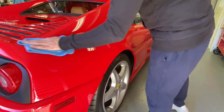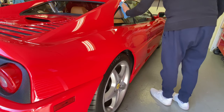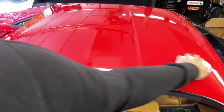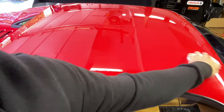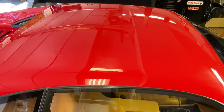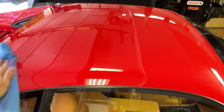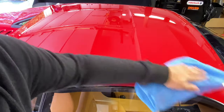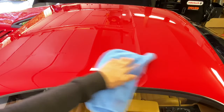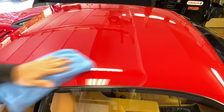The car is pretty much ready. I started the waterless wash outdoors so the sun could hit the car and I could see the dirt and contamination clearly, then brought it inside for the HD Cleanse so the paint wouldn't bake. When we apply the wax, we're going to use the heat from my hands to naturally break down the wax and level it out with bare hands, then buff it to a high gloss shine. Everything will be shot in 4K 60fps with no color grading.